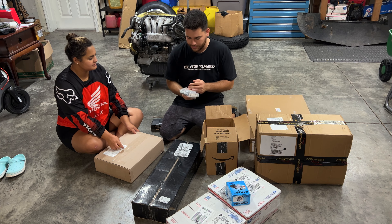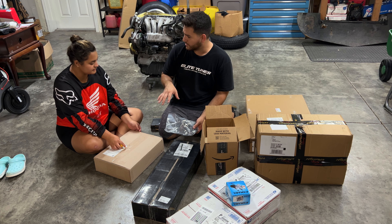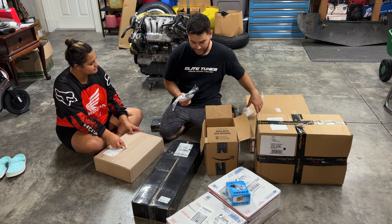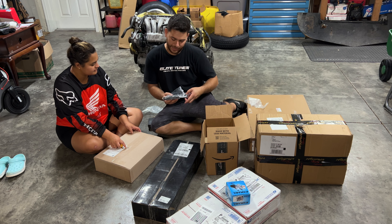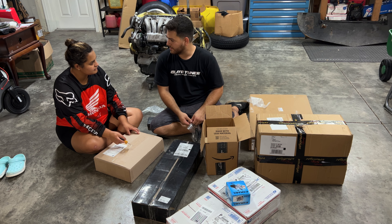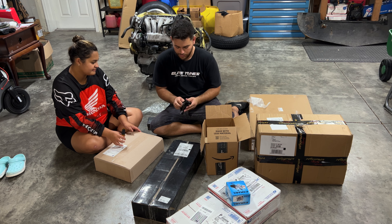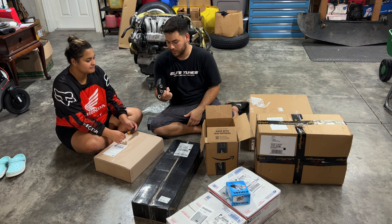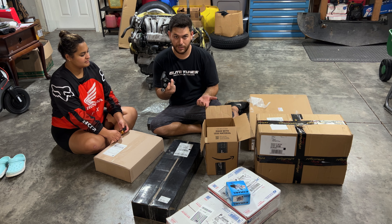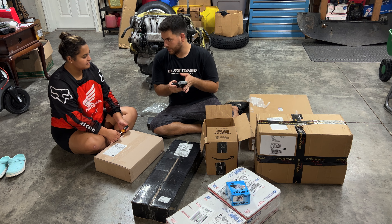This is the first one that's important when you're K-swapping your car - it's a bracket. Remember when we were in the junkyard on a CRV? The K-Series CRVs have this specific post mount that's necessary for when you're swapping cars. I got like 90% done with pulling it, but one of the bolts was backing up against the frame so it wouldn't let me actually pull it off. We ended up just buying a brand new one - OEM Honda, about 30 bucks on Amazon. This post mount attaches the mount kit to the K-Series engine.